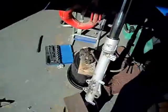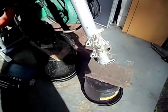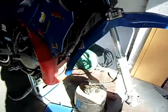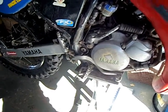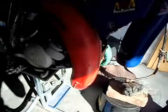You can even just tie-grip it to the frame somewhere, but I just find it easier to rest it on something. When you are resting the fork or forks on the other end with no wheel on the front, when you've taken it all off like this, be careful not to move it too much, because there is now more weight on the back end, so it can rock back too much and fly off the paddock stand or whatever you're using to rest it on. If you've got a paddock stand, watch it, because it can seesaw and then fly back off the paddock stand. You don't want that, because you've got no wheel, so it'll just fall onto all your downpipe and everything, and it won't be very good.